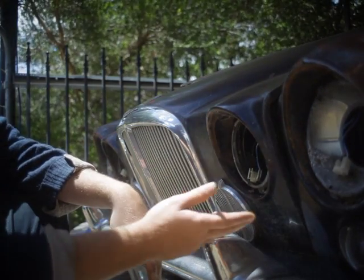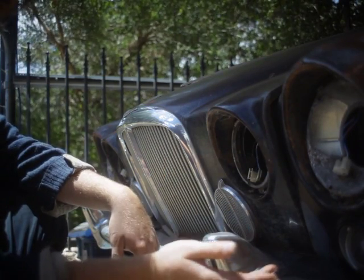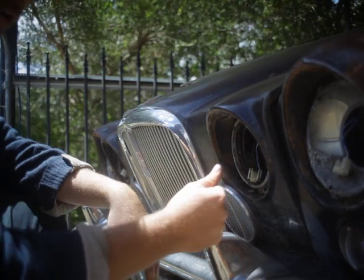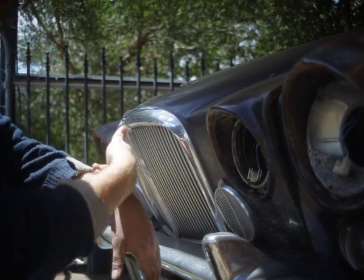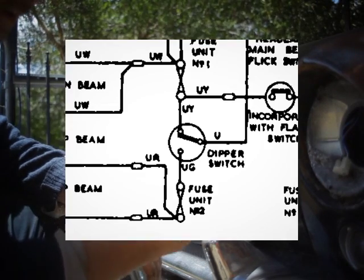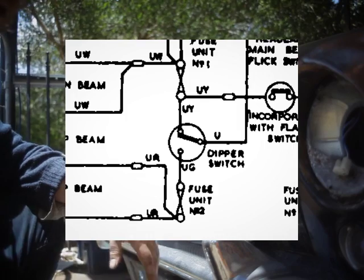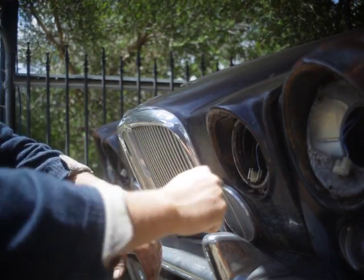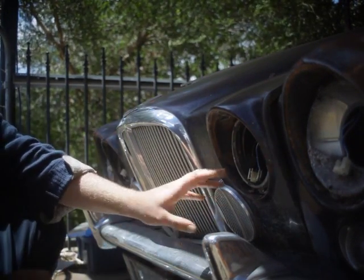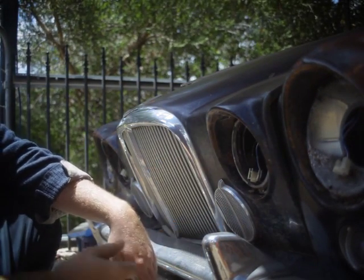The fact that it's not a switch, it's more of a junction box, and it actually points electricity to where it needs to be. When that's on, it'll route it one way and then put power to the fuses. I wasn't getting power to the fuses, but it actually routes power to the fuses one way or the other. So with that figured out, I remembered I actually smacked the floor-mounted dipper switch with a hammer. Just smacked it because it was so rusty.